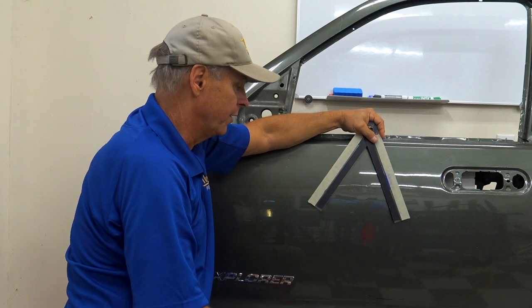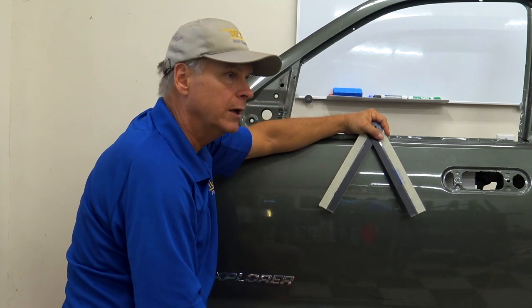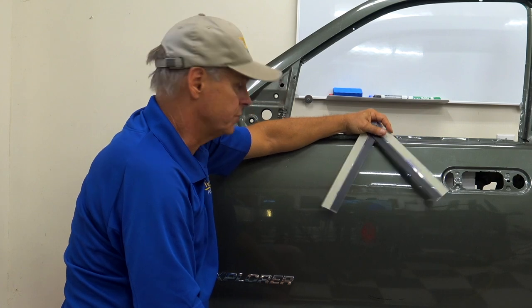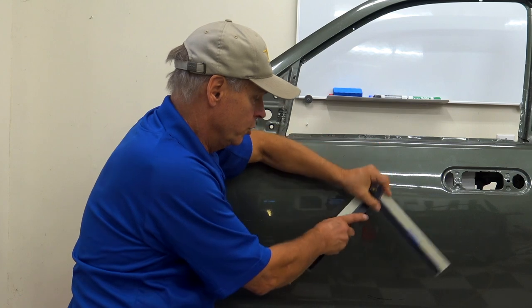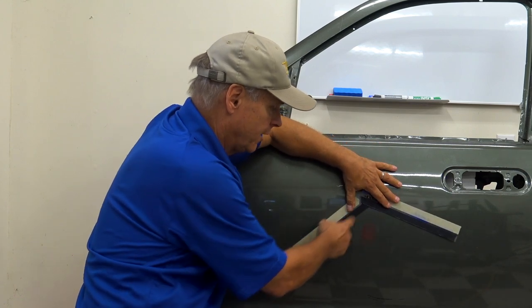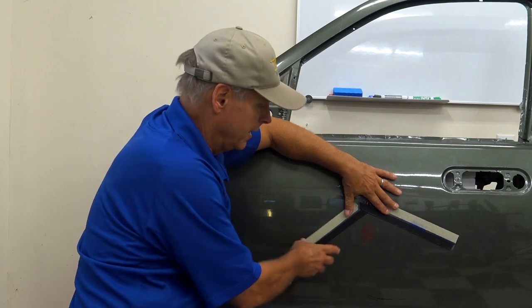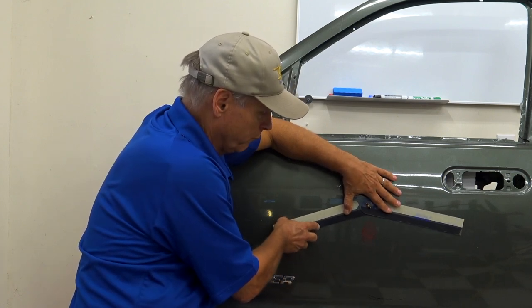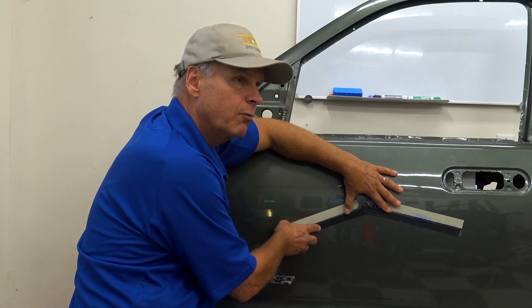Okay, and people think, well, no, I want to start on the impact point and move it. That's a fatal mistake. Almost everybody will do that, even body men. I'm sure some of yours have. You push it, but the energy in that crown, guys, has got to come out first. And we talked about your breakover point being right around there. Let's say that's about 160 or so, okay, 150.